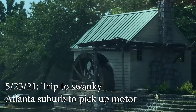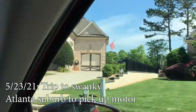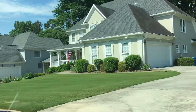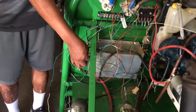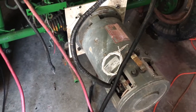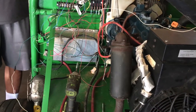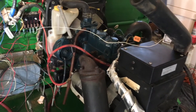So show me what this controller is again. Do you know what open source is? There was a guy out of Washington who developed an open source controller. This is a 500 amp, 144 volt — they call it the Paul and Sabrina controller. 500 amps, goes from 0 to 144 volts. It's got to have an external 12 volt supply. Other than that, it's very, very good. It's more robust than all the other 500 amp controllers out there.